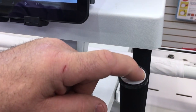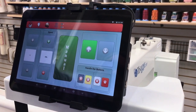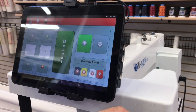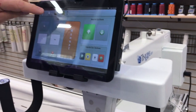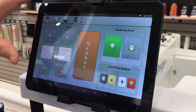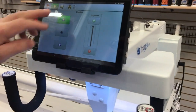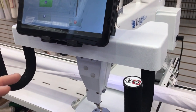Now when I touch the go button it'll wind a bobbin. The machine will continue running even after the bobbin is full because the machine doesn't stop — the bobbin winder stops. We have to stop the machine ourselves. Next, turn on the light: it's represented by a light bulb icon. The light never comes on when you first turn the machine on — you have to tap the light bulb. You can adjust brightness, and there's also a black light option useful for monofilament thread or tone-on-tone work.